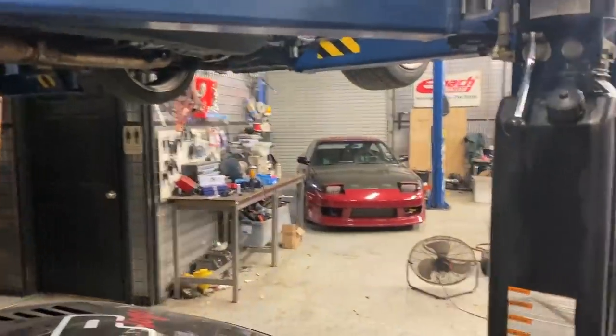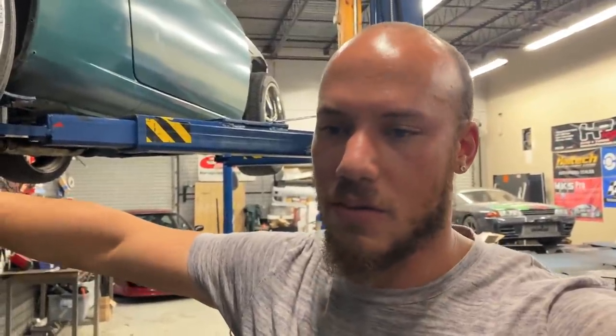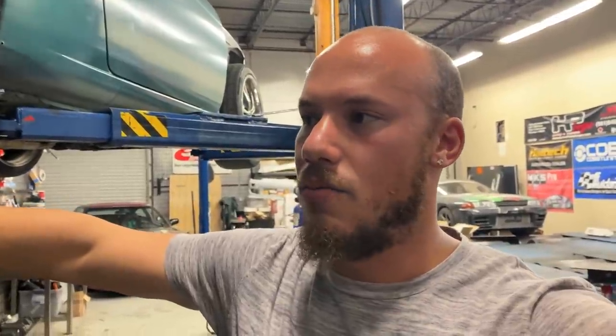So I'm going to wash it up, make sure it's all nice and clean, and it's going to find its spot right back here in the shop where it's going to stay for the rest of its life - probably not, but until it gets slid into a wall, hopefully not. After we're done with that, we're going to take the tractor off the truck, take the rear suspension off, and guesstimate how we're going to get that rear all set up. We're going to be getting all go-kart stuff for the back - it's about $400 for the whole rear setup: wheels, tires, the floating axle, bearings, brake rotor, brake caliper, and the chain sprocket.